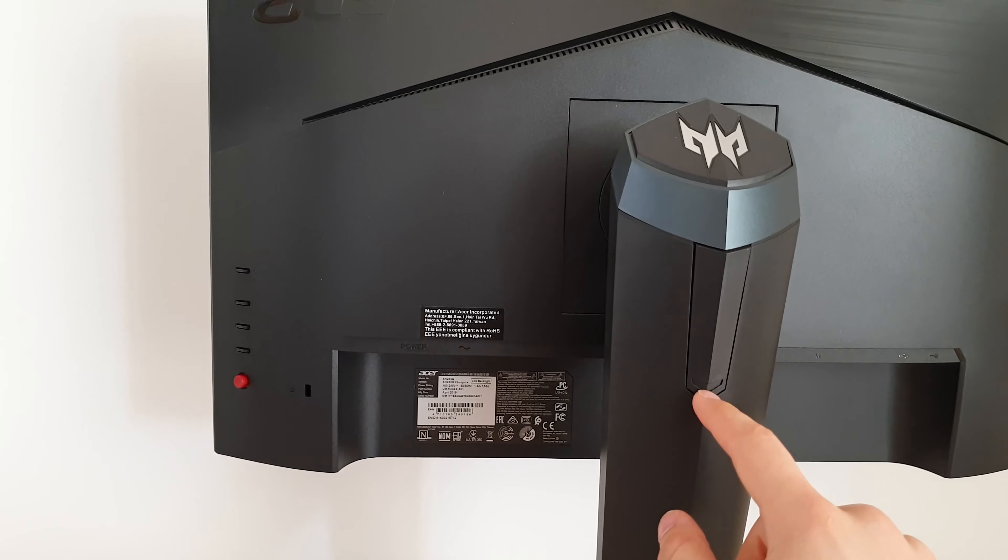There are some shifts in saturation levels comparing the top and bottom of the screen, but they're less pronounced than on some TN models. You can see fairly rich autumnal colours towards the top of the screen, but further down the screen they become a bit more faded. I've positioned the camera slightly higher than the central line to simulate the ergonomically correct viewing position — eyes in line with the top third of the screen rather than the middle.